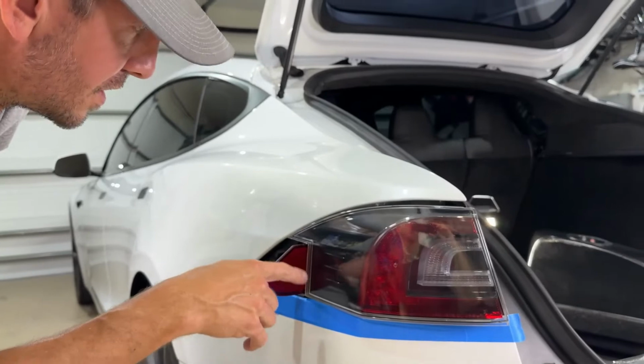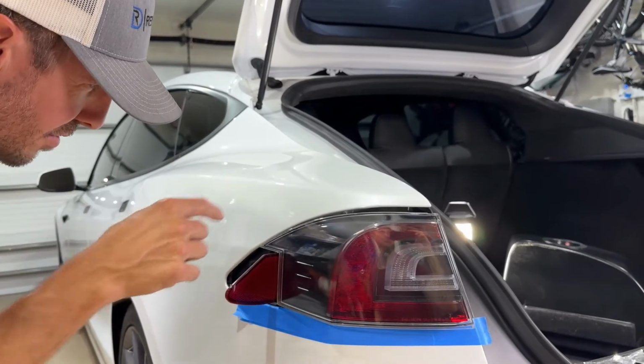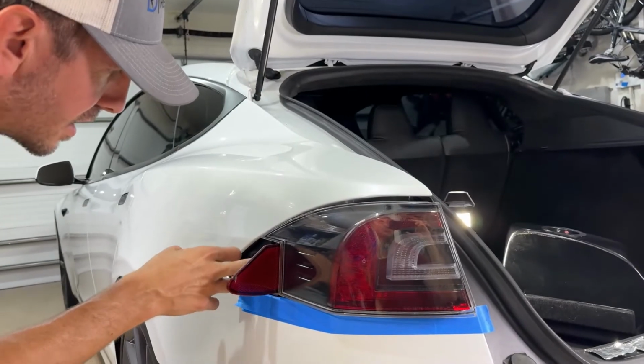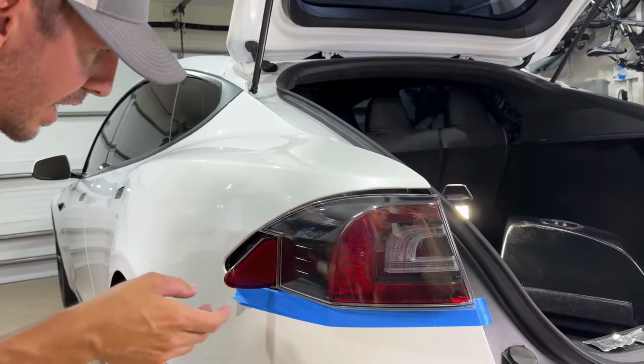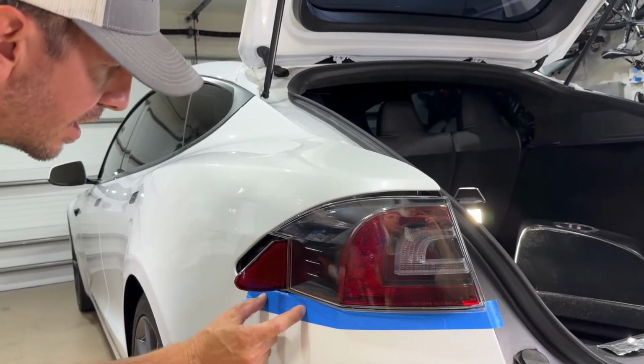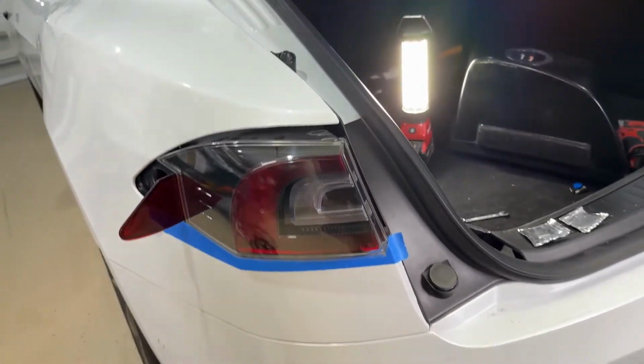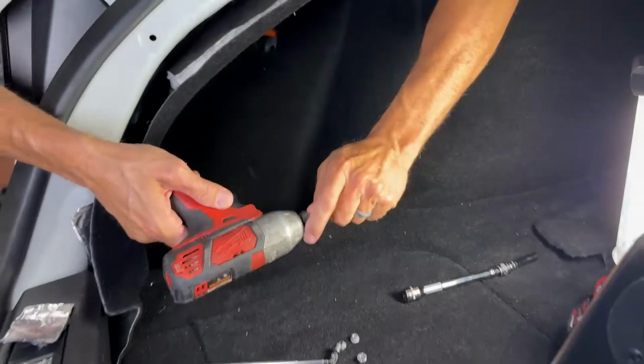Tesla's service manual doesn't say anything about taking out this Chargeport door, but I'm going to take off those 4 Torx screws on the backside and just kind of move it out of the way. And hopefully that gives me enough clearance to be able to get that box that's sitting down right here up and out. So that's the game plan now. So we'll go inside the trunk here. It's going to be a T30.